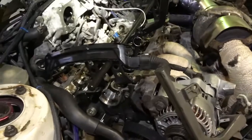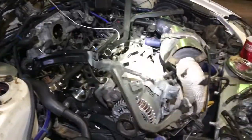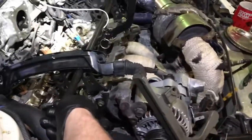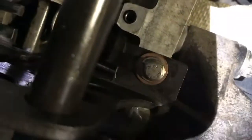I just thought I'd do a really quick video to show what I'm doing on my Toyota Celica. It's a GT4 ST205 with a 1994 3S-GT engine — just changing the valve stem oil seals in situ without removing the cylinder head. I bought this tool on Amazon for about 20 pounds. I only had to modify it a little bit — just cut small sections off with an angle grinder so it clears each valve in each corner.